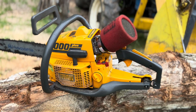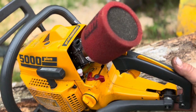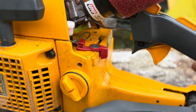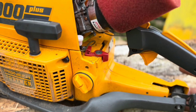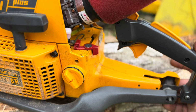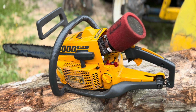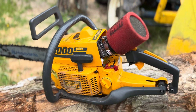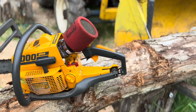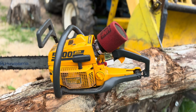She had an air leak. The intake boot was split, so I fixed that. And another issue I'm finding is the rubber mounts here for the handlebar. She tweaks on the throttle linkage there, and she screws with the idle. As you're handling it, this little bit of movement on the handlebar will cause the idle to fluctuate. So we might look at making this more of a solid mount. We'll see how this progresses. Now, I've been tuning it thinking one thing, and I'm thinking that it might actually be because of that.